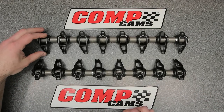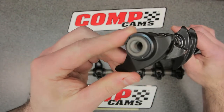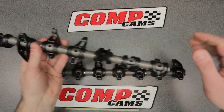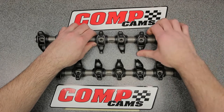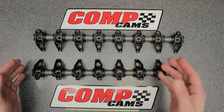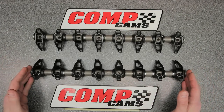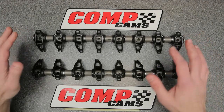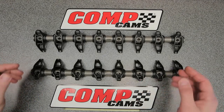I'm really happy with the construction - there are oiling holes on either side already threaded, so if you want to do a pressurized oil system you can. Everything is nice and tight, the shaft is nice and thick, and it's going to brace the cylinder head really nicely for higher boost applications - turbocharged, supercharged, whatever. These are called the Max Lift version, meaning you can go up to 675 thou lift with these because they're so stable - virtually no deflection due to the shaft-mounted feature.